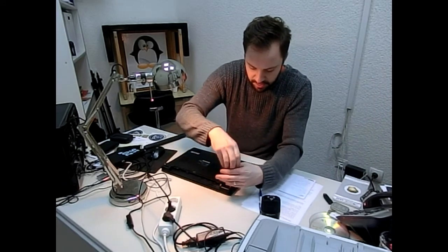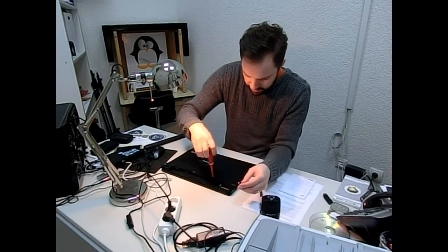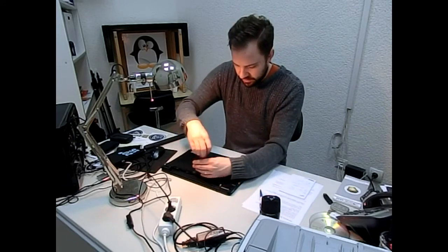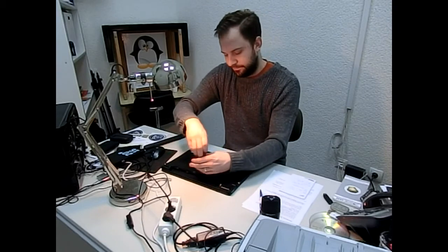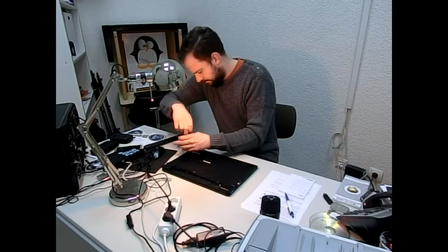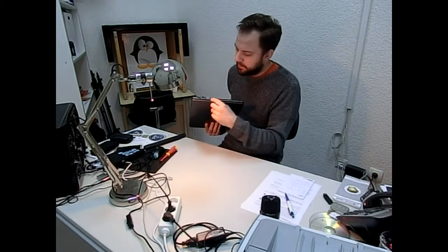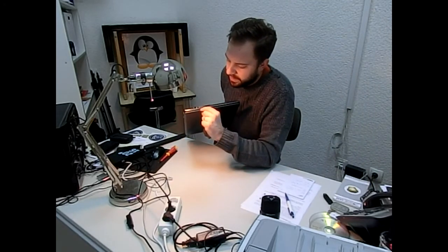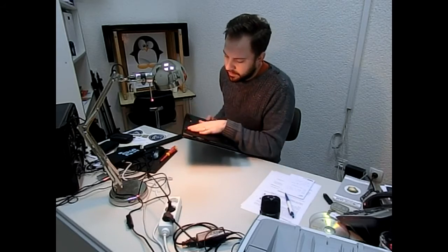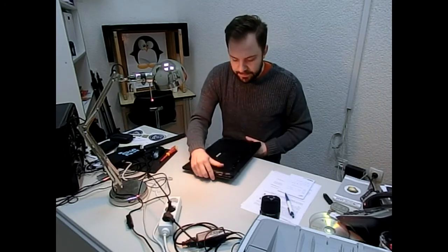There's a couple of screws here. You have to unscrew. It goes pretty fast. It's pretty fast. I like 10 or 11 screws. You can skip this part if you want. So let's open it up. Okay, so the whole thing, you have to be careful with this port. It has a RGB port, and you have to be careful because this plastic part or plastic lid goes over the port. So you have to open the laptop on the other side.